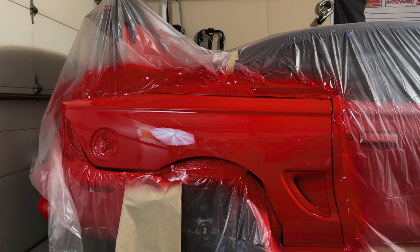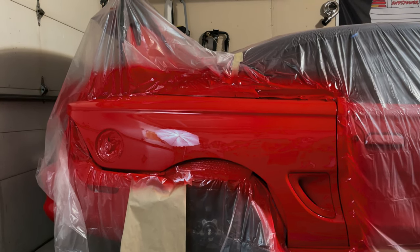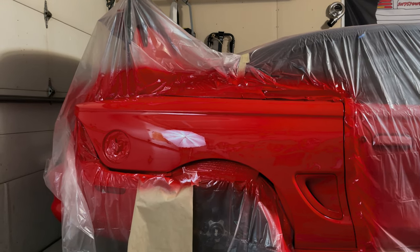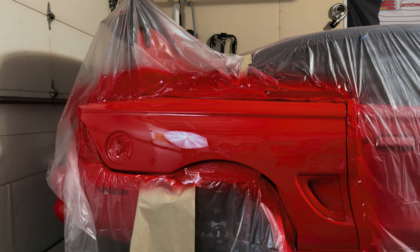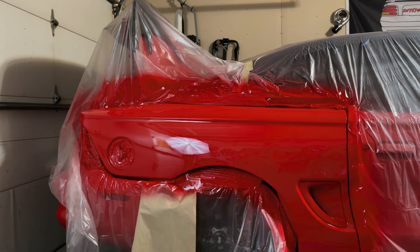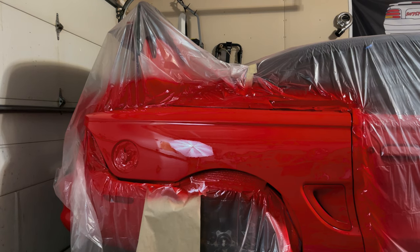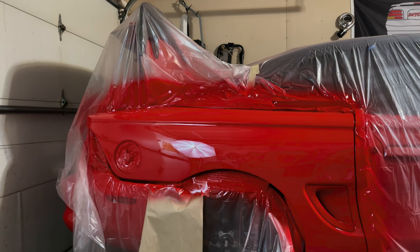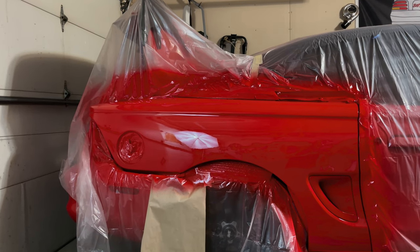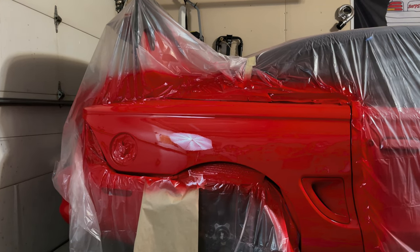I would have taken this car over there, but I'm having some problems. It was not really problems. If you guys have ever done this bonehead move on your mod motors, let me know. I got the timing chain and everything back assembled, put the timing cover back on, and then I look on the ground and the crank reluctor wheel is right there on the ground. So I've got to rip all that stuff back off just to put the crank trigger wheel on. So yeah, I've got to get that car out of the garage so I can start working on the white car. But this car is priority first.